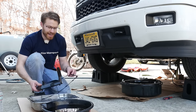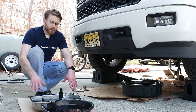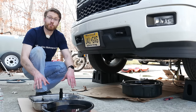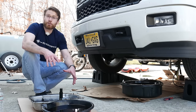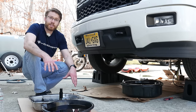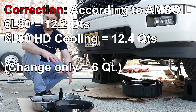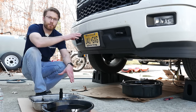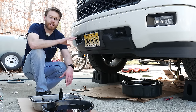Here's the filter and the gasket. There was still about just under five quarts left in the pan. Initially I thought when we ran the pump we would have removed most of the fluid from the pan, but it's possible if I continued running the pump I would have removed more — however the flow had slackened off significantly and I was worried about running the pump dry. Not a problem because we still wanted to remove all this fluid anyway. Now the truck takes about 14 quarts give or take. AMSOIL says it takes about 12.8 but I've been reading online that people have used 14, so have a little extra fluid on hand. If it takes 14 there's still about four quarts left in the vehicle — some of that's probably still in the transmission and the torque converter, which is probably holding most of it.